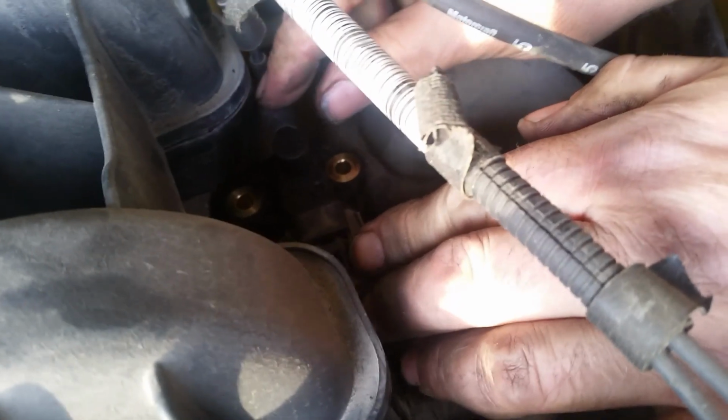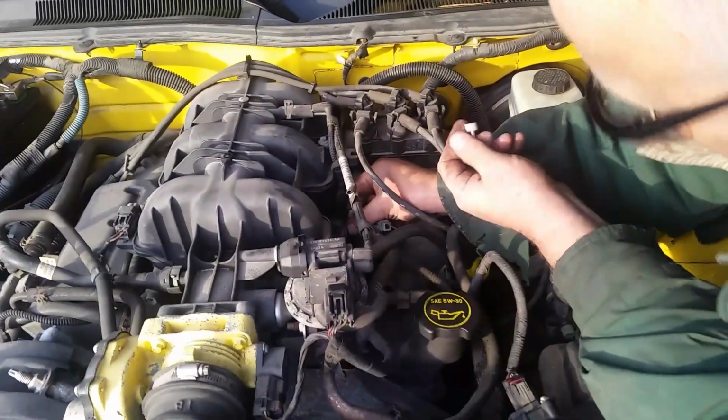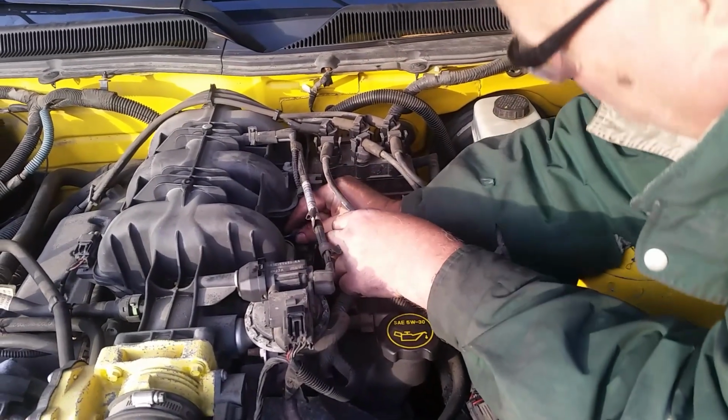We slide it right down into place here by wiggling it a little till the O-ring drops firmly into place and the holes are centered above the openings. And then we line it up perfectly for the final step. Drop the screws in and get them finger tight, and then we'll finish tightening them with the wrench.